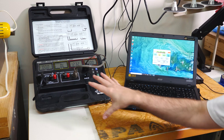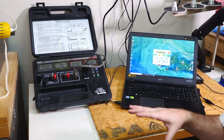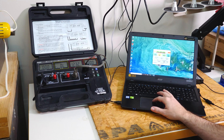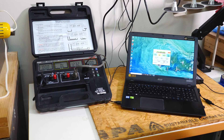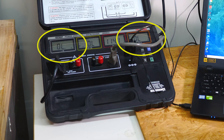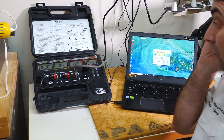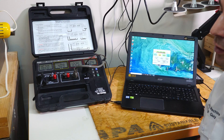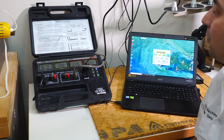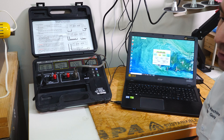We're going to get a baseline of how much power this thing uses. I'll start the machine and then sew. I'll just show you the data when we get to the end and compare it to what the servo motor does. When it first starts there's a big spike in power — you're looking at watts here, and over here you have the amps. While this machine is running and not sewing it's going through 161 watts and about 3.2 amps on a 120-volt system at about 122.6 volts. Now we'll continue on and sew while taking data as well.